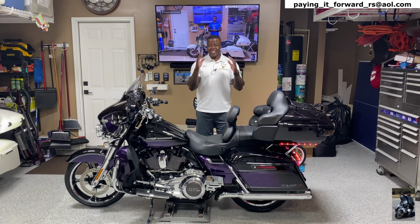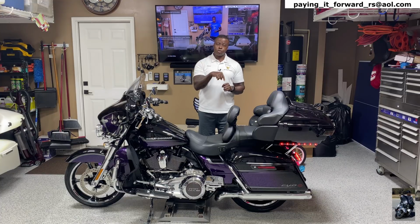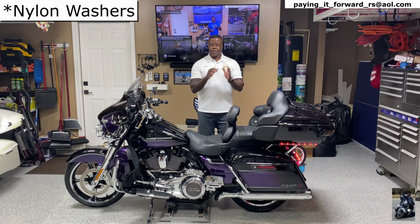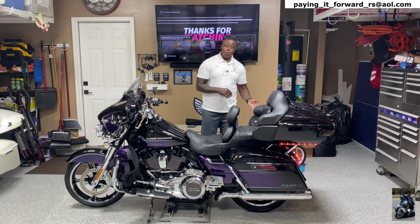All right, guys, so that was easy, extremely easy. Ten minutes tops is all it's going to take you to do that. The only thing required is a screwdriver. Take 2 screws out of the side, take that light out, disconnect it, put the other one back in. It uses the same screws, but replaces the washers that were on the screws with its own nylon washers. Screw it in, done. And clearly you can see that from the side now, you can see that light.